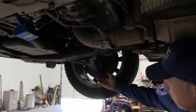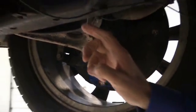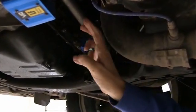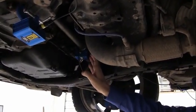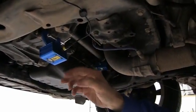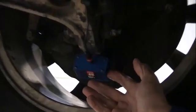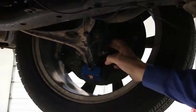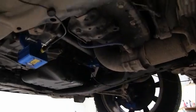Okay guys, this is the sensor that's vibrating. Now that's all the way out on the outer joint. Now this axle comes up and it's got an inner joint and a piece right here, a support bearing that goes to the tranny. Now if this inner joint was the problem, I would have gotten more vibration on this sensor, and I don't have that. And if something was wrong in the diff, this would be the one that I got my vibration on. But my vibration is coming from this outer one. So it's something to do with this outer axle, this outer CV. But these axles have already been replaced, and this inner stub has been replaced.